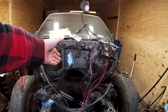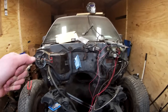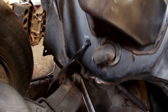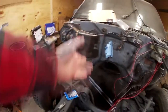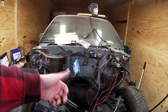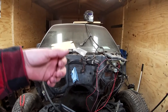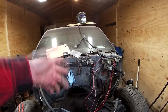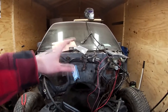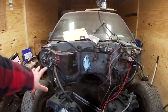My 1992 NV3500 5-speed trans. So I'm going to start off with the computer. Since it was fuel injected, that pretty much controlled your whole fuel injection — it would pick up your RPM, your O2 sensor, map sensor, and send signal to your injectors when to pulse and all that stuff. And since I'm going carbureted, I just got rid of all of that.